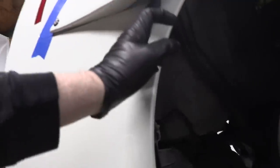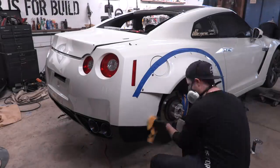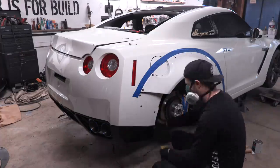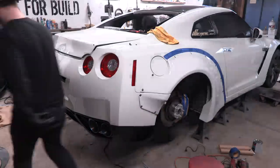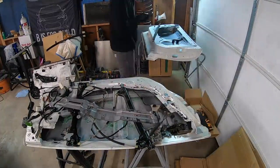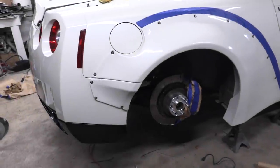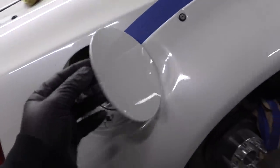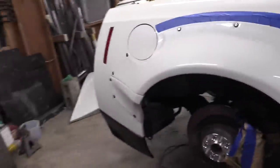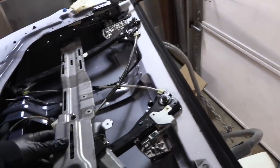Got the first flare on there and it looks really, really good. It's loosely fit for now and we had to move some holes a little side to side and up and down, but it all lined up. The hardware from Downstar uses a well nut with a beauty washer and allen nut combo - great for wide body. We trimmed the last little piece, fastened the bumper down, and the gas cap clears by about a millimeter - that was close. Meanwhile, Kyle finished the door: glass in, new pins and plastics in the door panel, all buttoned up.